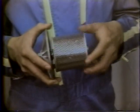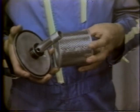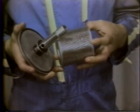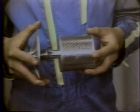The oil filter is the cartridge type. As the element in the filter is gradually plugged by trapped dirt, its efficiency is reduced, and so the element should be replaced after the first 500 miles, after 2,000 miles, and every 4,000 miles after that.